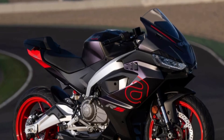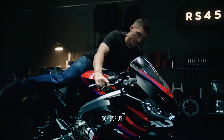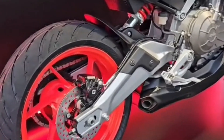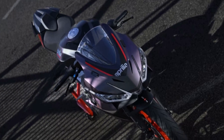The new engine is combined with a highly respectable chassis, which features a prestigious aluminum frame, a feature that no bike in this market segment possesses. The engine crankcase is used as a load-bearing element, a solution inherited from the RS-660, developed with the aim of containing weight as well as improving dynamic qualities and driving pleasure.